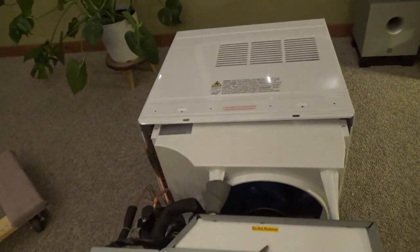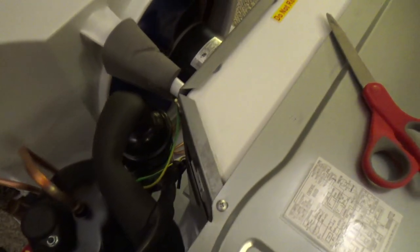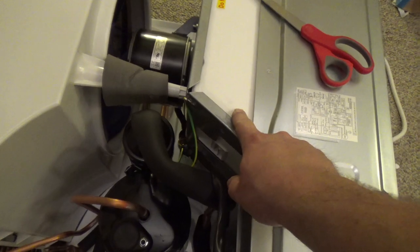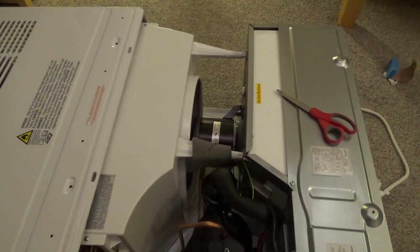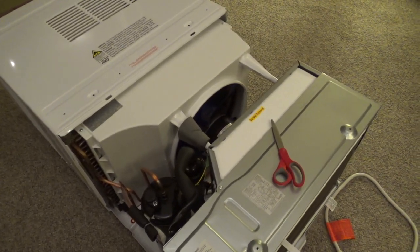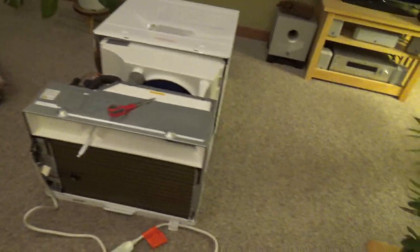Alright, let's put it back in. It looks like it would be relatively easy to clean — this would come off and give you access to the evaporator area, and then you'd have to take the fan off. Historically, Frigidaire over the last decade or so was pretty reliable for being easy to clean, but maybe this isn't so much the case. It's going to be on my deck and the condenser is going to stay dry so it should stay relatively clean.